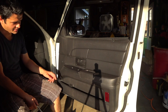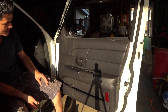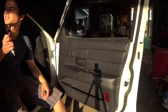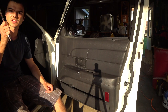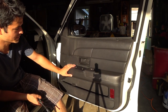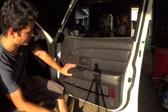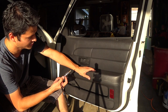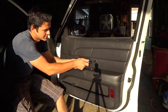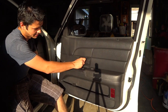The first step is we're going to get the speakers installed. It's very simple — you got one speaker in each of the front door panels, and then another speaker on each side of the rear deck. The first thing we're going to do is get this door panel off to install the speakers. Grab a T30 with a 3/8 drive ratchet with an extension, and we're going to get this little bolt here popped out.